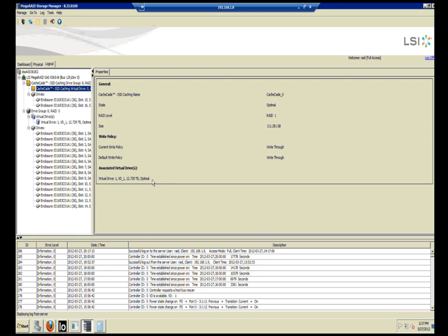Sure, yeah. It's similar to, for example, if you have an 8-drive RAID 5, some people would choose to put their OS on that RAID 5 as well as everything else, their data. Right. Now, you can do that, and it's sharing the 8 drives, the same volume. It's just all simpler. But some other people would say, well, even though I only have 8 slots, I want to have 2 drives just for the OS in a RAID 1 and 6 drives for the data. Right. Just depending on how hard you're hitting it.